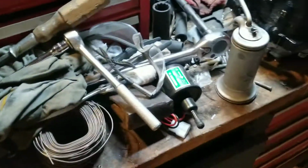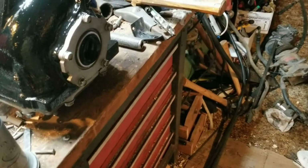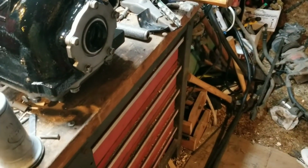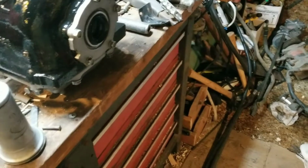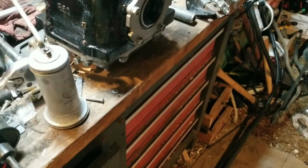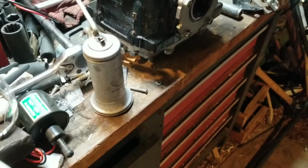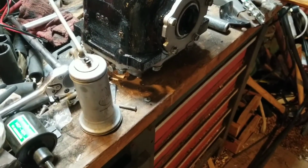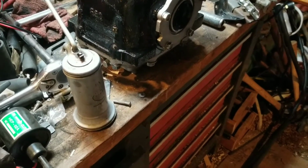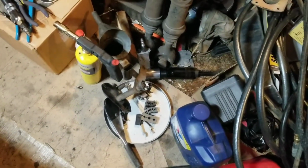But anywho, yeah, I'll put some primer on, the heavy rusty metal primer, because that stuff sticks to anything real good. That's the Rust-Oleum stuff. And then put on that undercoating, and then bolt back in all those underside components. I also ended up taking off all the brake lines and the emergency brake, which is all this fun stuff sitting over here. So just made it a little easier to get the stuff down there.